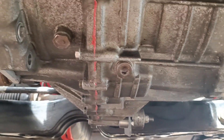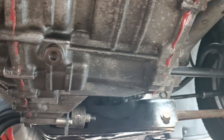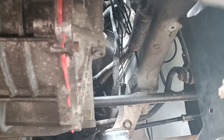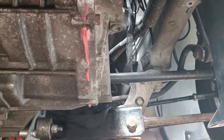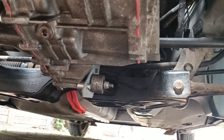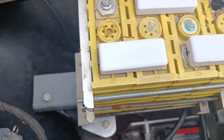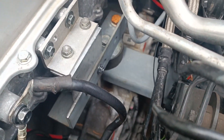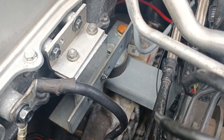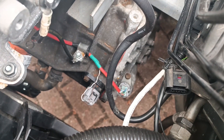Let's start down here with the motor, which is actually a transmission — a hybrid transmission from a Toyota Prius. I got it completely for free, and if you don't, it'll set you back about 200 euros. It's got two motors inside but I'm just using one of them. Here you can see I fabricated a torque arm. There's a cross member running all the way across, and the transmission is suspended from that with two rubber mounts. Down here we've got the temperature sensor and resolver.